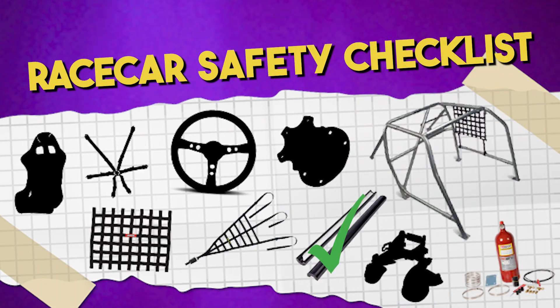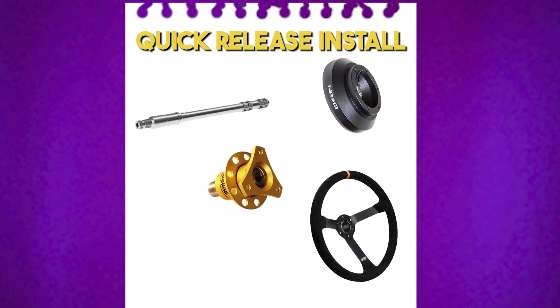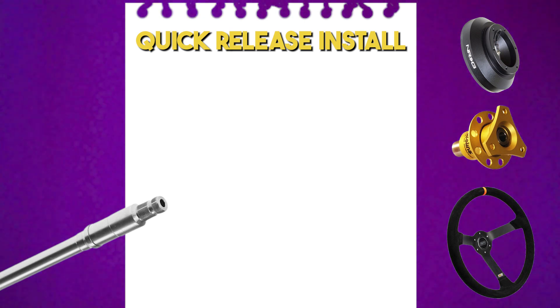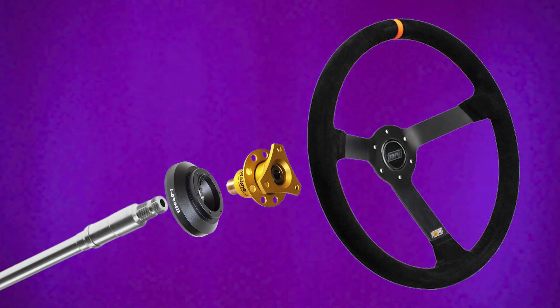So after breezing through the cage padding install, we can successfully check that off our checklist. Now we can move on to a steering wheel and quick release, which is arguably one of the most important. When we talk about installing a quick release in a car, there are four parts: one is your steering shaft, two is the hub adapter to go from the steering shaft to your quick release, three would be the quick release itself, and four would be whatever steering wheel you decide. Most steering shafts are splined and keyed so your hub adapter can only slide on one direction. Take your hub adapter, slide it onto your steering shaft ensuring it's straight, then bolt it down. Grab your quick release, take the hub side and bolt it onto the hub. Then bolt the other portion of the quick release onto the wheel, pull your quick release action and slide it all together - and now your wheel will come on and off.